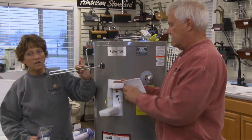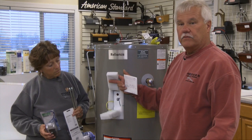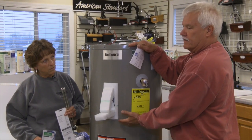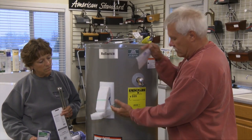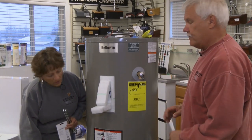This is what your element looks like inside — a basic element. All these water heaters are high recovery, meaning if you start with a cold tank, it's going to energize just the top element so it takes less time to heat that portion of water. Then as soon as the top is warmed, it's going to send the power down to the bottom element to heat the rest of the tank.